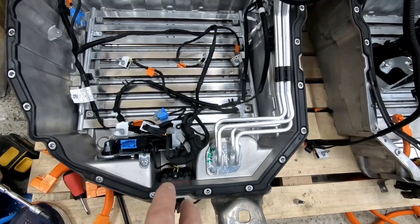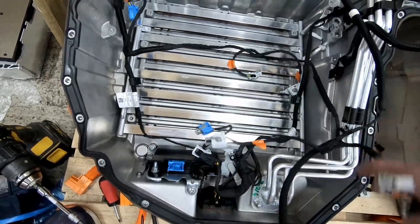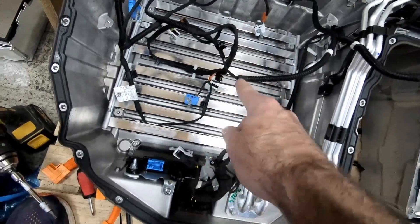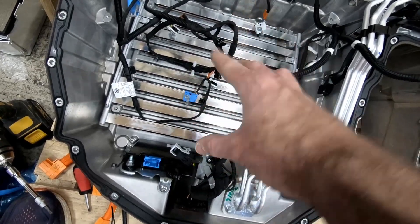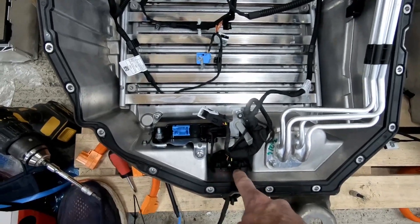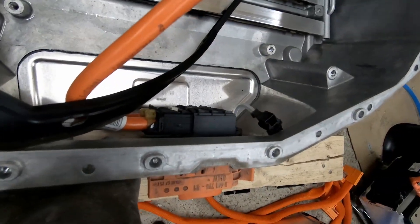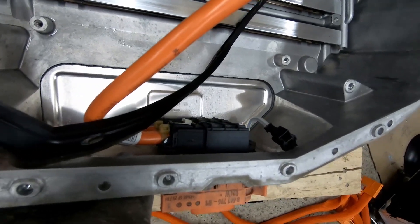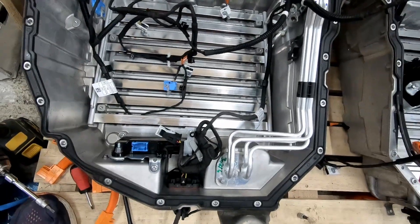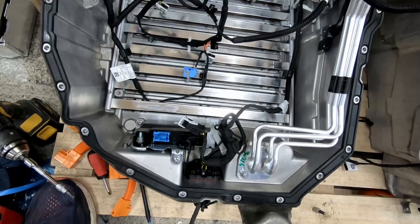So we've actually got two separate little mini wiring looms going on in here. Both of them feed out of the main BMS module, but the ones that connect via the blue connector are a separate loom from the others. That's purely internal in the battery pack and goes to each of the smaller BMS modules on the actual battery modules. The black connector goes two ways: one is out to the rest of the car, and the other routes around to go to the high voltage junction box — presumably just a connector confirmation that it's plugged in. On older versions of these battery packs, they were all together and you'd have to unwrap the entire loom to split them out, so this makes things a lot easier.